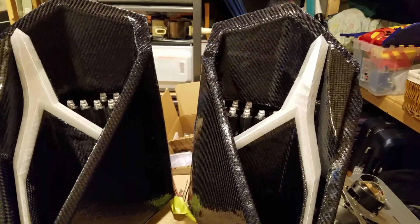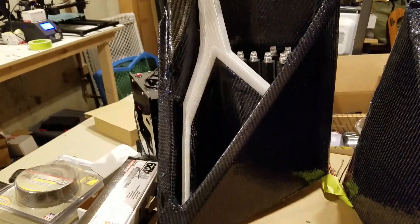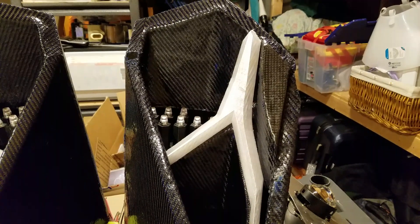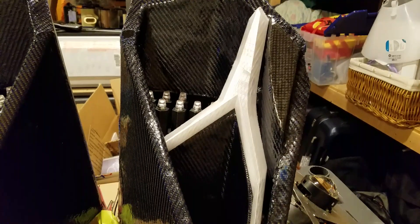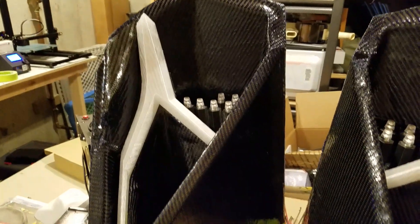I use that one to print the headlight buckets. These are done in ABS. The running lights are actually done in PETG — that's a good material for the light emission properties, it scatters the light very nicely. These are filled with LEDs. We also have LEDs for the turn signals that you can see here. These particular parts were just skinned in carbon fiber Kevlar and will also be skinned with another layer after smoothing them out.